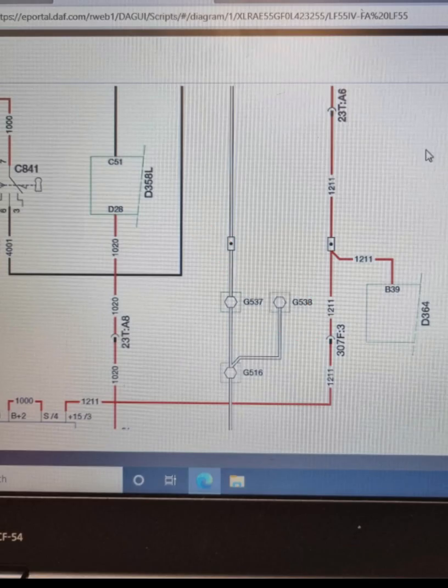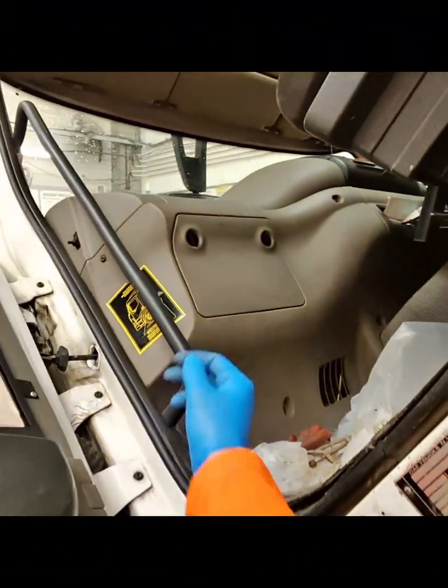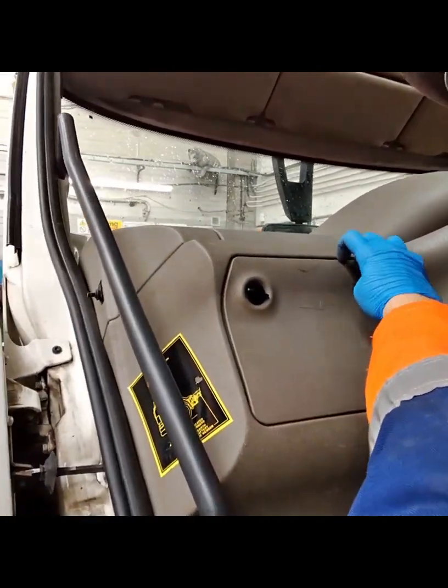I need to go through RMI and identify location information for fuses and connectors. Once I'd checked the fuse location and number, the wire number and connector locations, I was then able to start in the fuse box and work my way to the alternator.